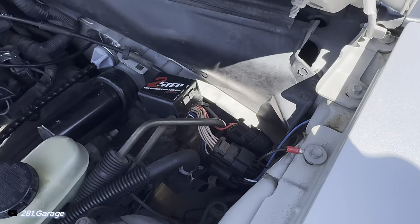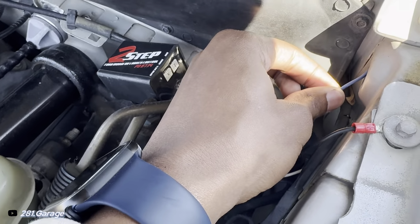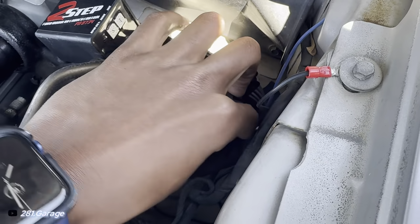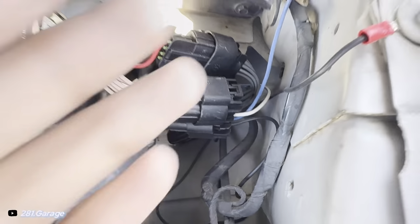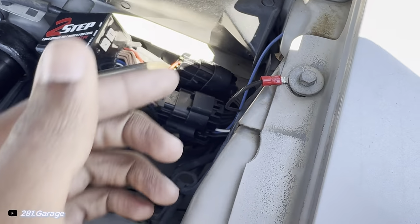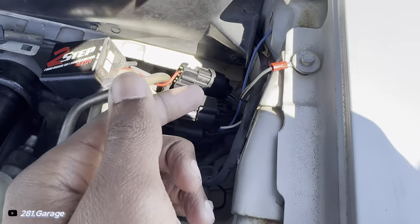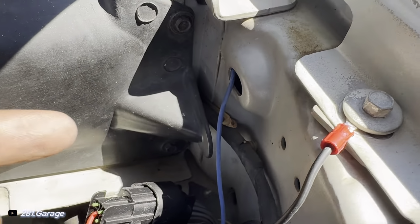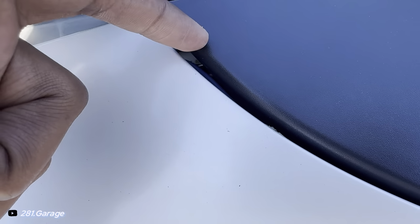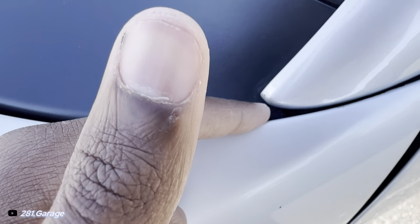I was really lucky. So as I was saying, this blue wire is for manual cars, and this blue-white wire that I tucked up in there, that's for automatic cars. I don't know what wire that plugs into. I have a manual, so I use the blue wire. So what I did was I took this blue wire, fed it through that hole, fed it up here somewhere, fed it, oh, there it is. You see it right there. I gotta hide that.